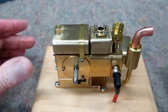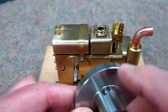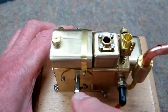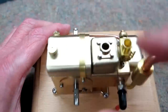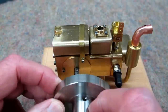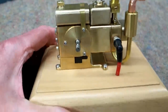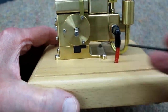When it comes to timing the engine, you really don't have to worry about it. The set screw for the flywheel that contains the magnet matches up to a flat on the crankshaft, and those flats are directly opposite each other. So when you put that on there and gently engage that set screw with the flat, you are automatically timed. This is your Hall Effect sensor down here.